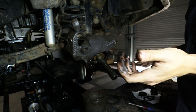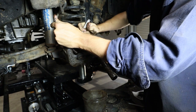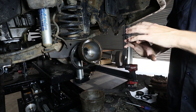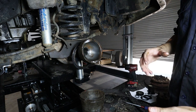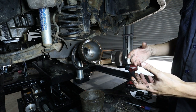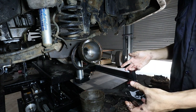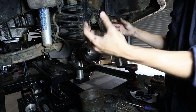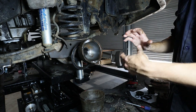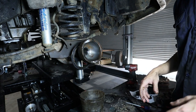Now we need to take off the rear seal, which is six 12mm bolts. Now we have everything disassembled — we'll cut these seals off and throw them in the bin. We want to clean absolutely everything: the knuckle, spindle, any bearings you want to reuse. I'm going to reuse the wheel bearing, so I'll wash out the old grease and repack with fresh grease. Now's a great time to deep scrub everything since we know it's been leaking oil. It's a lot easier to do while it's apart.